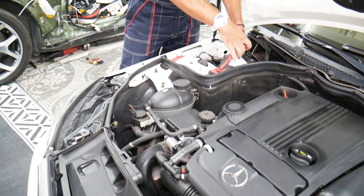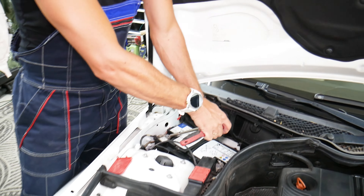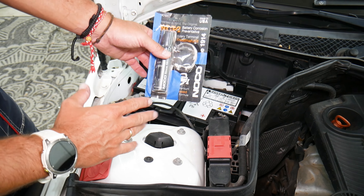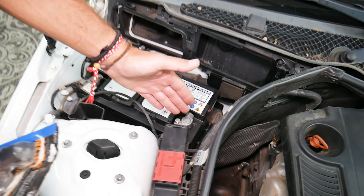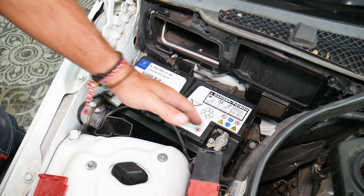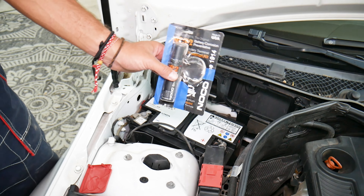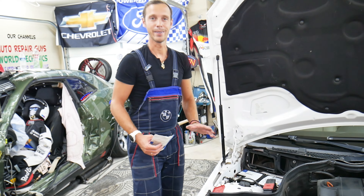Something important: if you don't want to have corrosion or oxidation, you can use a battery terminal treatment kit. You spray them, and if you live in a wet climate or you have snow, humidity, or rain, it's going to protect the terminals against oxidation. That's the proper way to connect it.